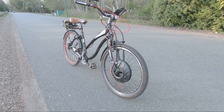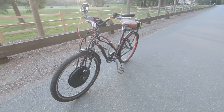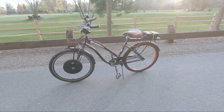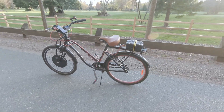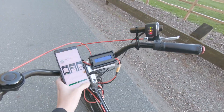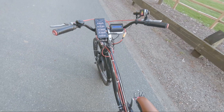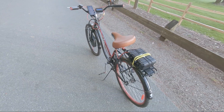Since I am stuck indoors, I decided it would be a great time to make a video about the electric bike I built last summer. This is the final product after I converted my mom's 26 inch cruiser bike. It uses a 500 watt BLDC motor with an integrated 10 amp 42 volt controller, and it's the perfect combination as it acts more as an electric assist than a fully electric bike.